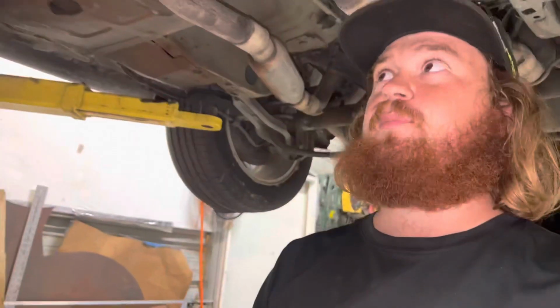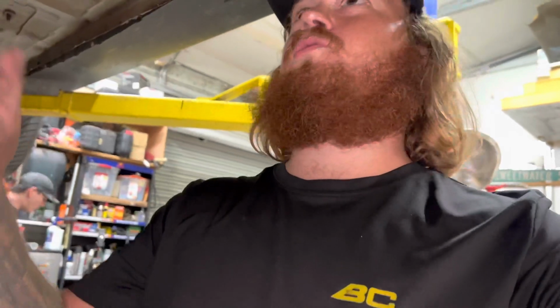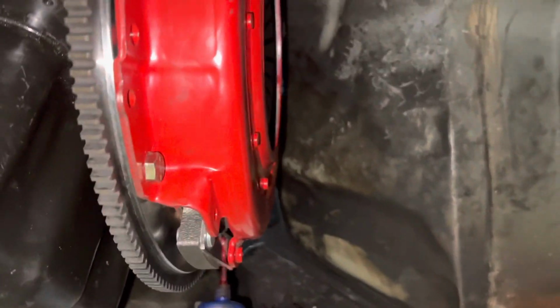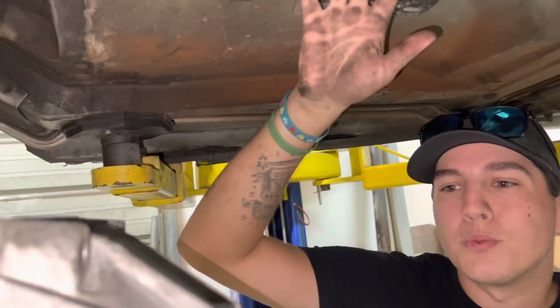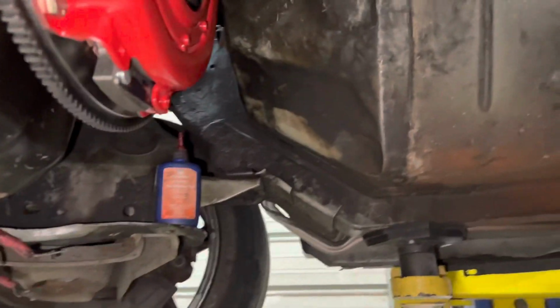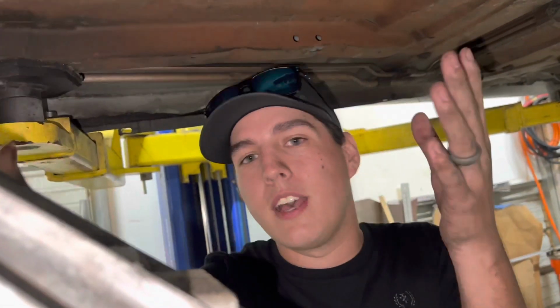Yep. So this is going to be the fun part, because whoever designed this tunnel, engine, transmission setup didn't consider that you ever might have to pull the transmission or reinstall it. So they don't give you much room here at the tunnel. So this has to go up, in, like, you have centimeters at a time. You have to essentially go in at an angle, which is really hard to do with a very heavy trans and big bell housing. So the thing we figured out is if you clock the trans a little bit sideways, get the starter end in first, and then you can kind of clock it back the way it needs to go.